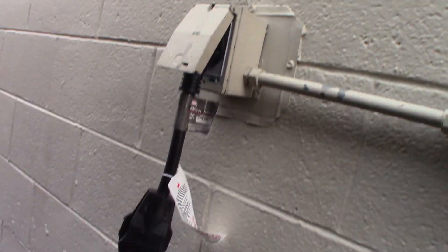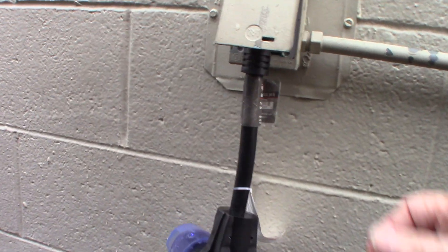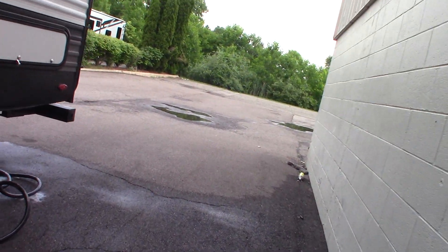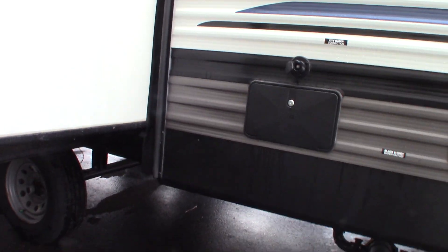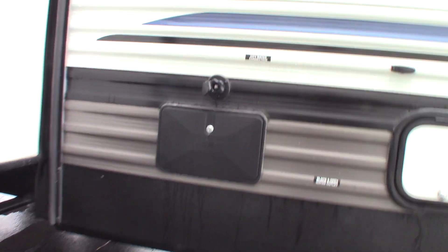This is your power cord — it's a 50 amp cord because it's a 50 amp system. We also give you a reducer to take it down to 30 amp, and a smaller one to take it down to 20 amp. You obviously can't run the air conditioner off a 20, but you can always plug it in for packing or in an emergency.